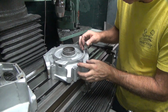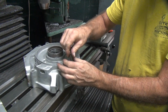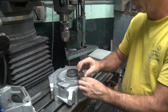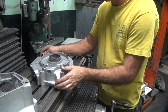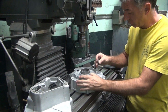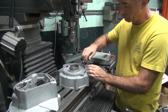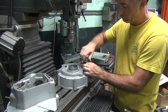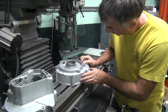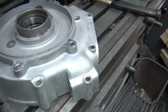Same on these other holes because they all have short helicoils in them. See, they all go way in there, but the helicoils don't go in all the way down. But these ones here aren't pulling, so even though they're short, they're good. This one looks like it's some sealer or something in there. But it goes in. It gets tight right there though, see? Something wrong with that helicoil. You see there's a big gap in there or something in there. Can't see what it is.